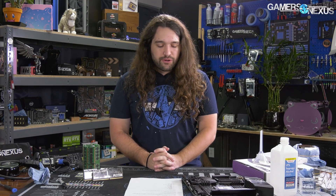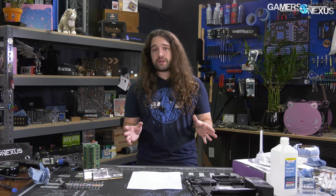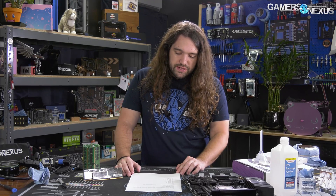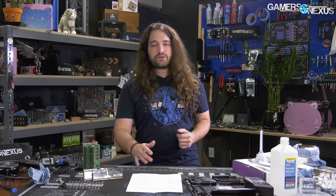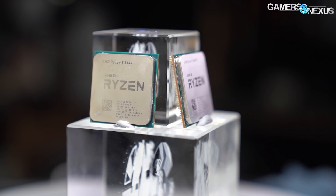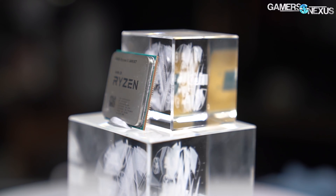That'll wrap it up. As a final reminder: you'll see a '+100' next to the 3600XT stock number — in the XT review, our chip was running about 100 MHz higher than the official spec, not due to any motherboard cheating, just really good silicon quality. This is definitely something we can recommend getting into — you can do all this stuff on the 3600 as well, though it caps out at 4.3, sometimes 4.4 with a really abusive voltage. You do need memory controllers of good quality for higher clocks and better timings.